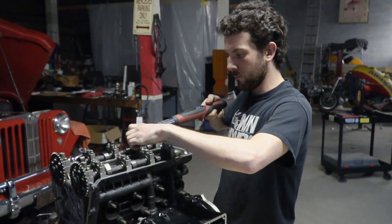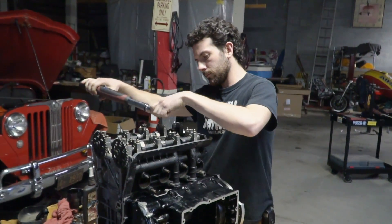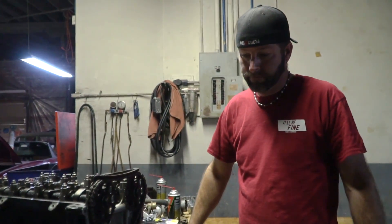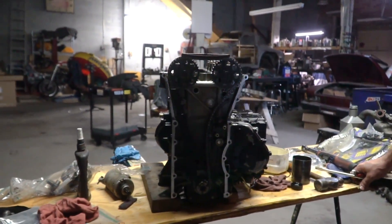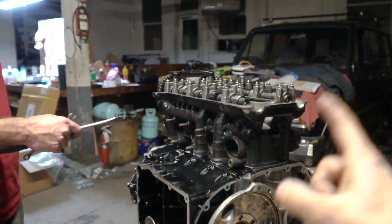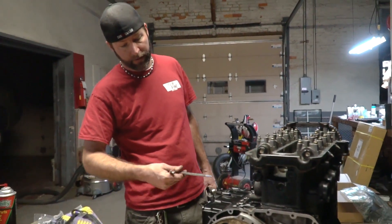And then there's not going to be much left on this engine other than putting it on the transmission. Cams are back in, in time. The chain is on, tensioner and everything. So from here: valve cover, timing cover, oil pan or crankshaft cover. And I'm going to say this is the oil pan right here.